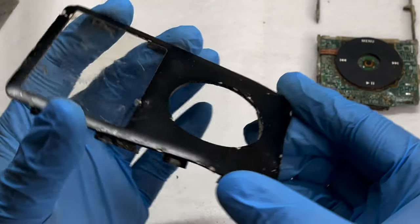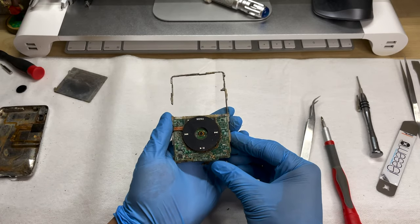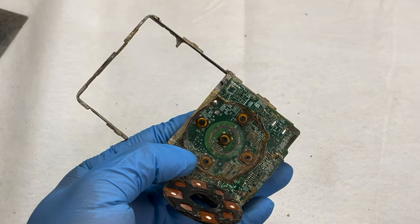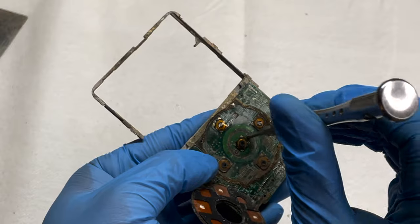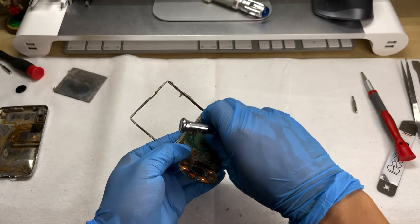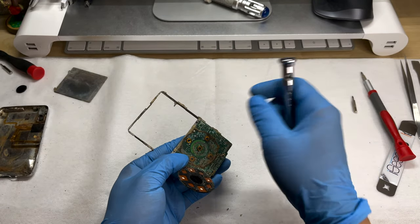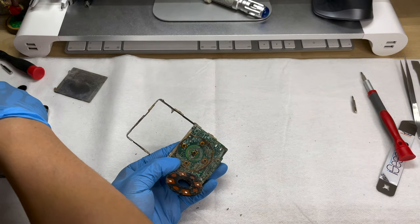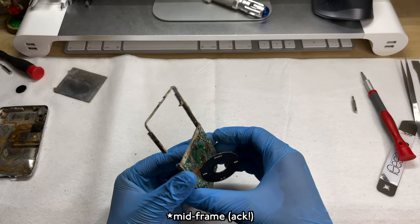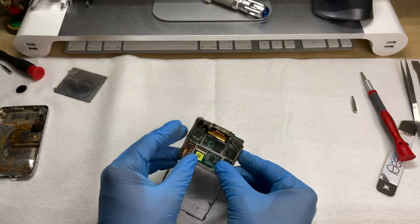And yeah, you can see just how much damage this front plate has sustained. Let's turn our attention to the logic board. Now, beneath this click wheel, we have these two Phillips head screws here. Hopefully these won't strip. These are the screws holding the logic board to the chassis, so once they're off, the logic board should be free. There is still some adhesive holding the logic board to the chassis, which I expect should be quite brittle by now. So if we just very gently push,